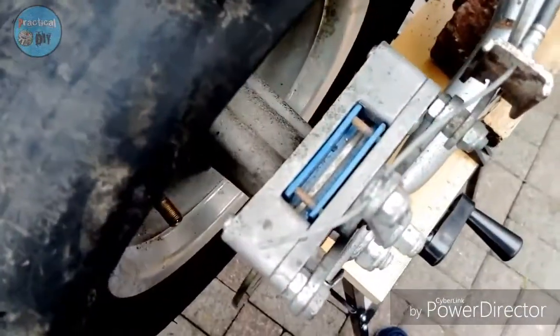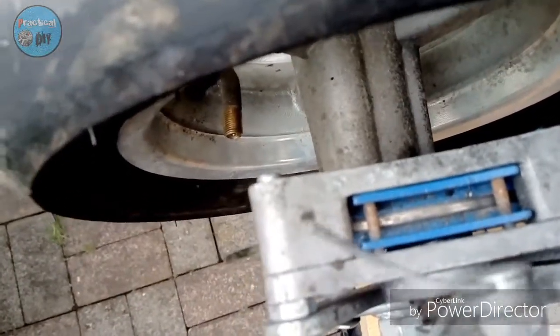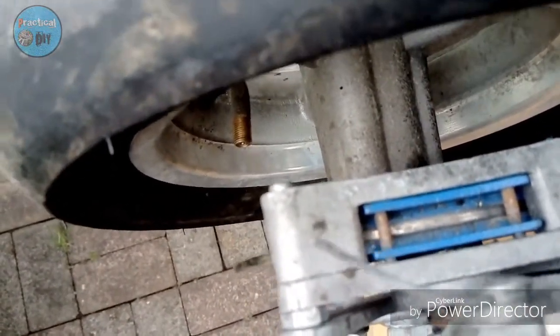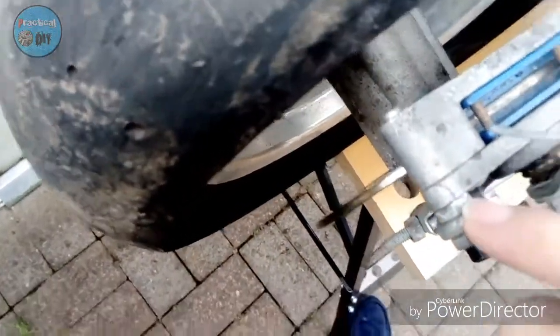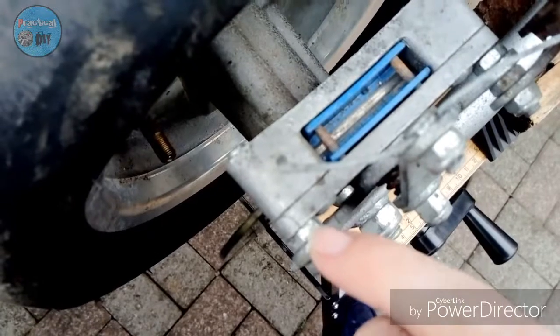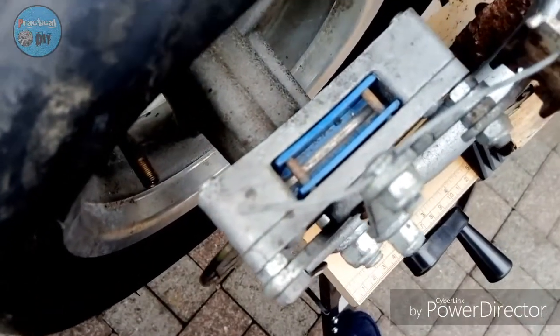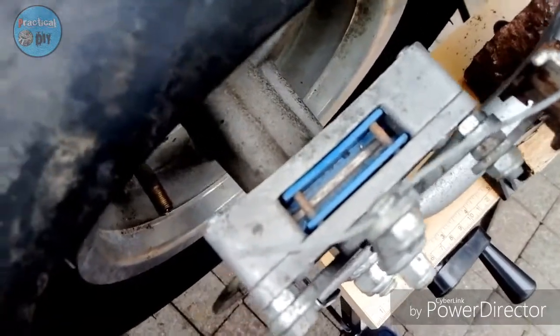Also, when I was looking at the brakes, there doesn't seem to be an awful lot of movement, so when I actuate the brake, the slider's not actually moving. I think it's pulling right the way up against this over here. Against this nut. I don't think that's supposed to be there. I think it's supposed to be a bit clearer. But we'll have a look at the instructions and see the exploded views, see how it's supposed to look properly.